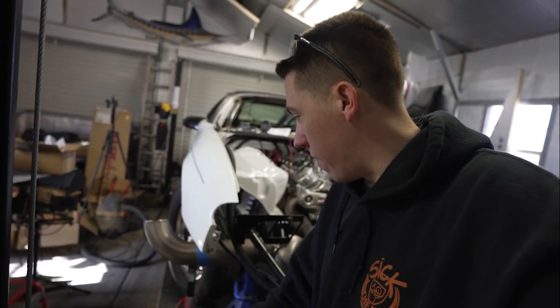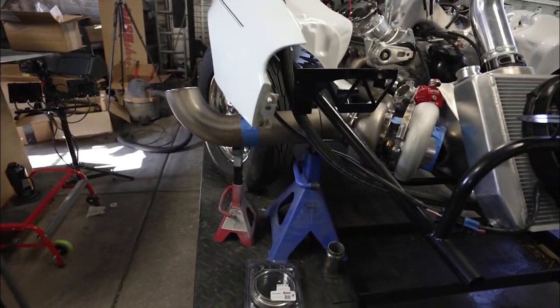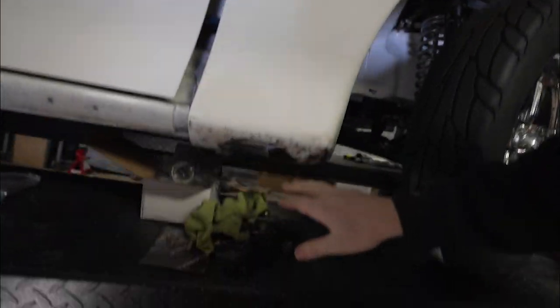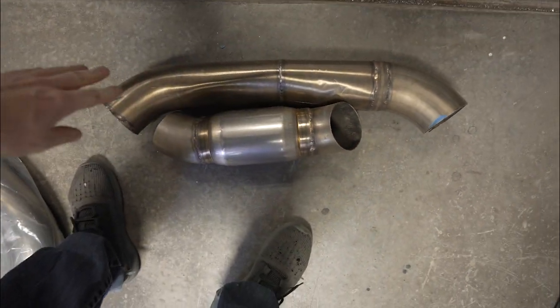So just in case we want to run that class, I'm going to cut this back a little bit and put a v-band right here. All I gotta do is build from the v-band out if I ever want to change up the exhaust. I actually cut up the old exhaust on Salty — it used to come up and go through the fender and out a hole right there, but I had to smash it to clear the tire.